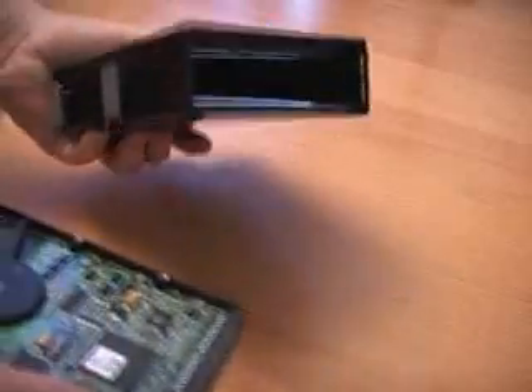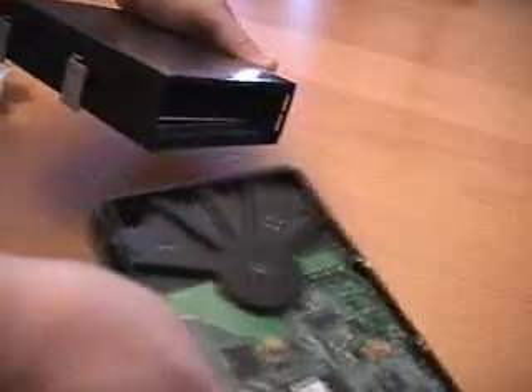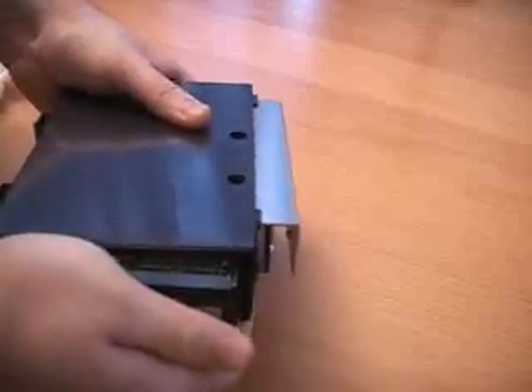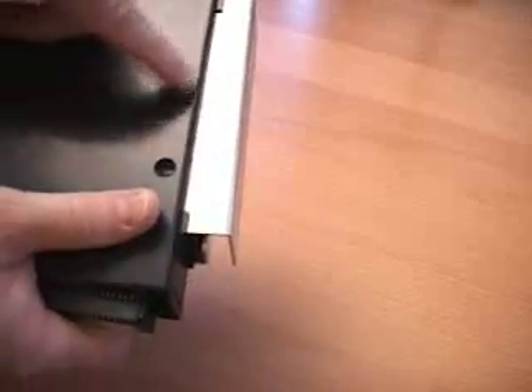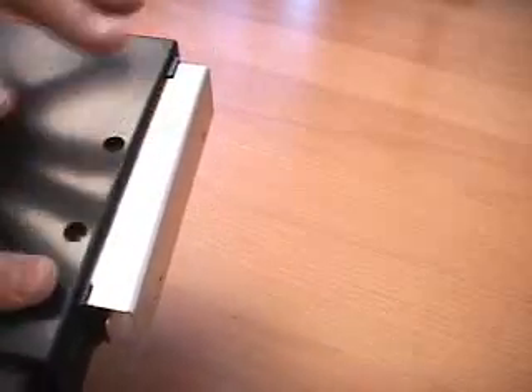Installing the hard drive inside of this is extremely easy to do — just be very careful and take your time. You can see the orientation that I have the product and the hard drive; it goes slipped in like so. Take your time and push it all the way to the back. Once it's all the way in you have a couple of options. You can put two screws here which anchor the drive to this bracket that goes attached to the case. You would want to do this if you're installing the product inside of a vehicle or a case that you're transporting a lot. However, by doing this you're going to increase the vibrations from the drive itself to the case and that will of course increase the loudness levels.